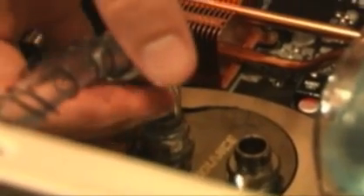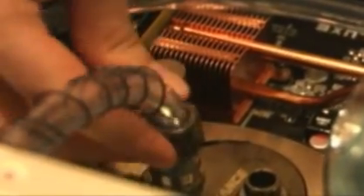First we have spring wrap that we put on to prevent the tube from kinking. This is not completely necessary, but it helps prevent kinking and also looks cool. We've got it onto the fitting now, and if you have trouble getting it on all the way because the opening is too small, you can insert a pair of needle nose pliers into it and open it up — that helps widen it a little bit to make it easier to put on. Then just put this over it and screw it on.